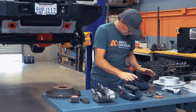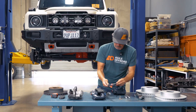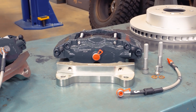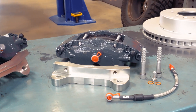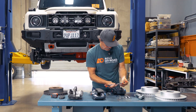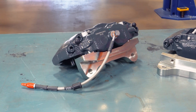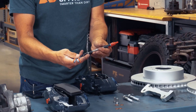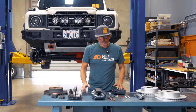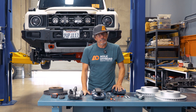Let's look at the other parts included. The brake lines need to be adapted to this banjo fitting — going in through the side there's a banjo fitting and a couple of washers. Alcon always uses Goodridge for the brake lines, which is the same brand already on the Grenadier, and we're only replacing this small section right here. It's a really clean setup.